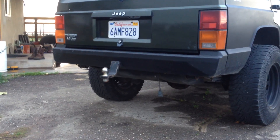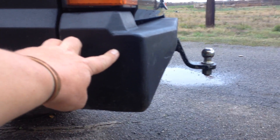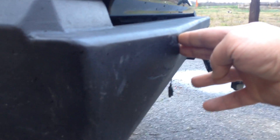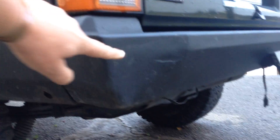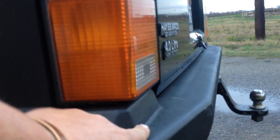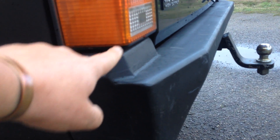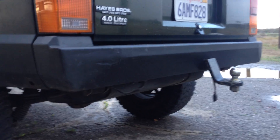Looking at it from the side, this is actually two by six box tube quarter inch wall, and then the piece you see here is actually two by two sandwiched together. You can see where I bonded that to fill in the void because I didn't want to warp it by welding. Then all the sheet metal pieces are 3/16 sheet metal that I covered it with to smooth it out. I capped the ends - also 3/16 - and built it up so it fills in the void that would be between the bumper and the tail light. This is a super strong design, and I went with the two by six and two by two because it's what I had laying around.